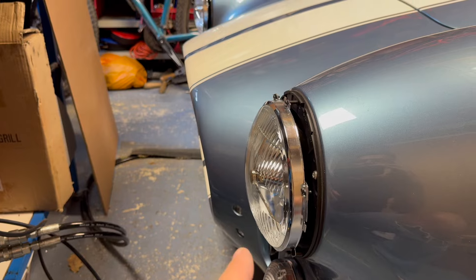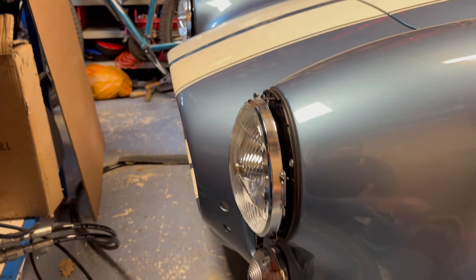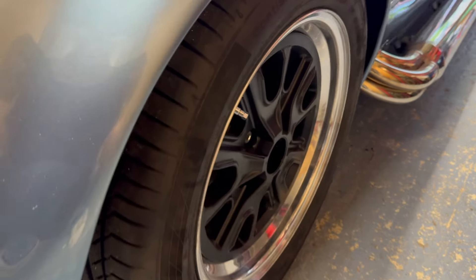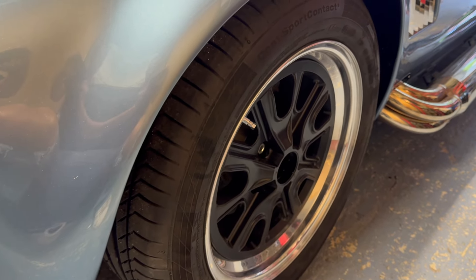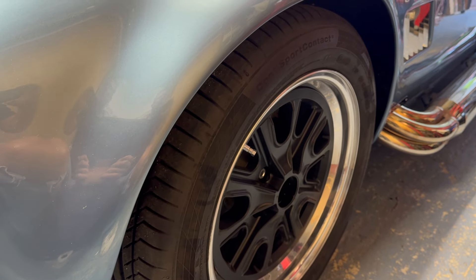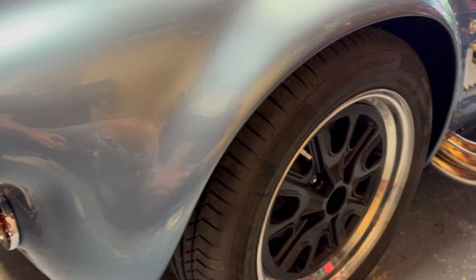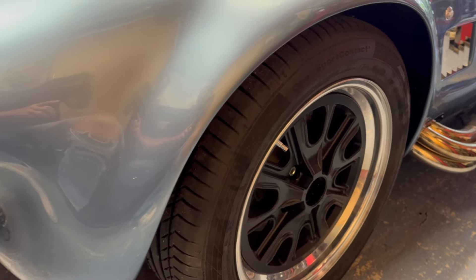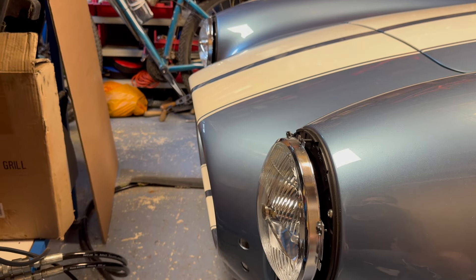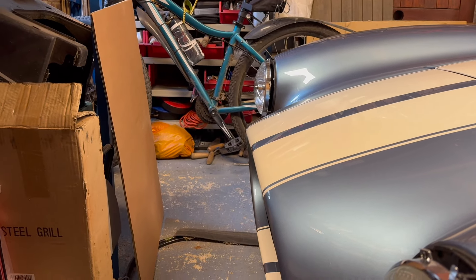The headlights are one of the few things you're allowed to adjust at the IVA centre. Try to get them as accurate as possible. If you can take your car to an MOT test centre, they'll do the lights and tracking for you. Make sure you've got about four mil of toe-in on the front wheels, so the car attempts to pull itself straight after a turn.